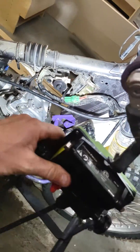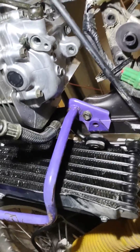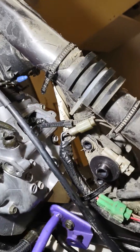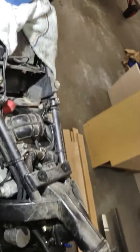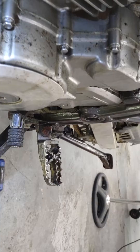This is a quick video to show you how to check if your camshaft is timed to your crankshaft, which you want when it's in compression stroke of TDC. The first step, as explained in the manual very clearly, is to find the T mark in the timing inspection hole.